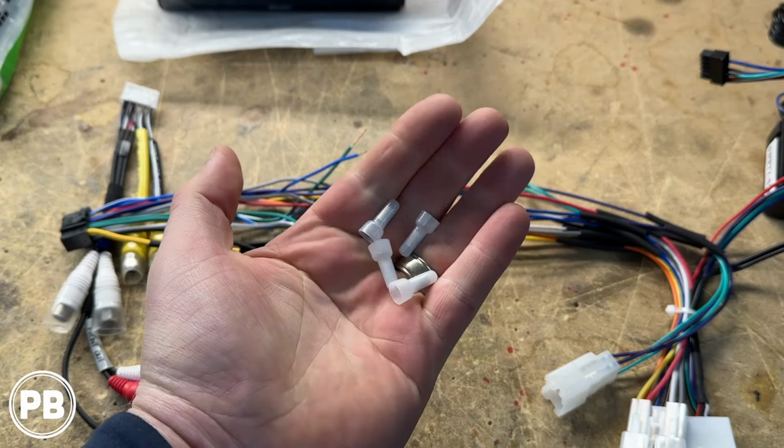We are doing a backup camera on this van, so we'll show you exactly where to connect your reverse trigger and the parking brake. You can use an Alpine bypass, which we can link that video and part in the description as well. With that being said, we're gonna go ahead and move our heat shrink up and over those connections and we're gonna shrink them down with a heat gun.